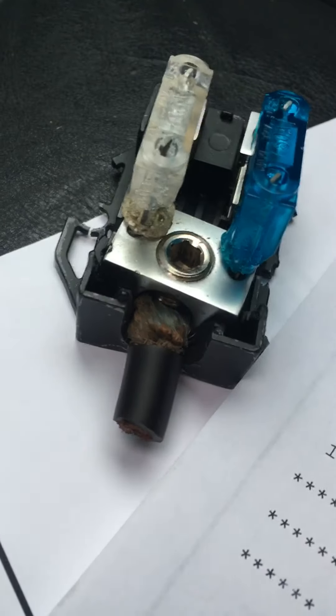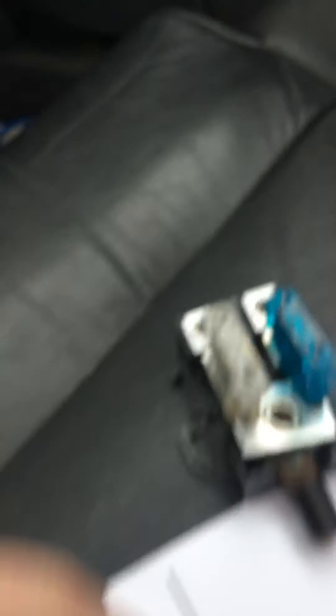A lot of that lab work is free, and a lot of the parts they fried out because of their shoddy job — then they made me pay for another one. They put a four-gauge wire here, and then two four-gauge wires right there, going right to my amps drawing 1800 watts, and it melted the fuse holder. See how hot it got? See the screw size? That set screw is for wire twice as big.